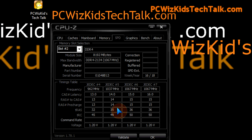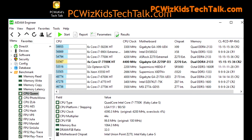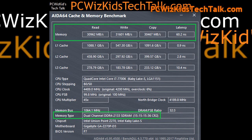CL15 is what I've got it running at in this machine. In AIDA64, these benchmarks are showing us a little bit how it's doing, running at default — I'm not overclocking anything. In the CPU Queen, there are some results of the entire system working together with the CPU and the Gigabyte board, and then the timings and the latency. It's not necessarily the fastest, but it is pretty good here, scoring comparably to another system also running an Intel Core i7-7700K. So it is fairly fast compared to that other system.